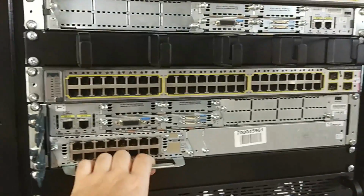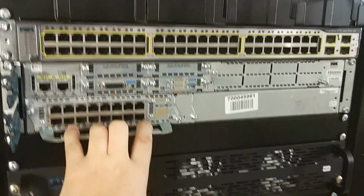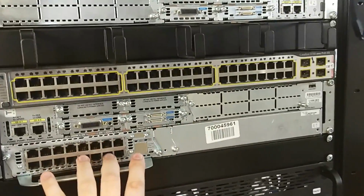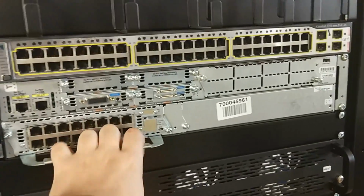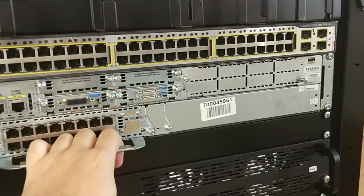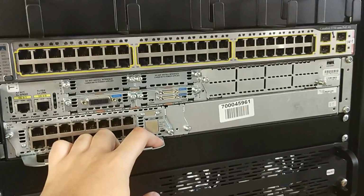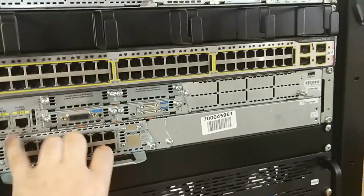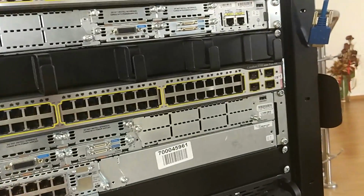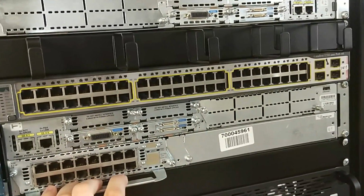Oh, this is the good one. This is a Cisco 2821. It's a 2U router. It has tons of expansion options. It is a brilliant thing for the lab. If you're interested in a collaboration lab, you probably know about this particular device, and it is a really powerful one. I upgraded this one. I added this switch module, and I also added these serial port cards.